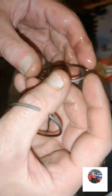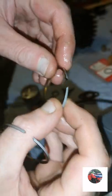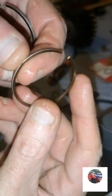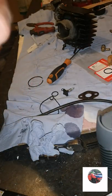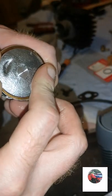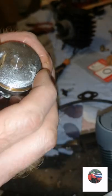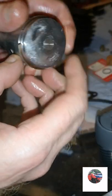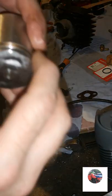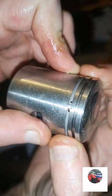These are both different - like a DDR piston. This is the bottom one - it's the same width all the way around. You can see the top one's beveled, I'll show that in a minute. Get this bottom one on first - that's the bottom ring on, nips over that circle. Now get the top ring on - you can see it's beveled.